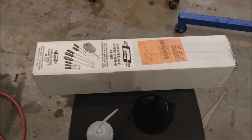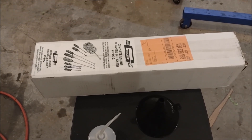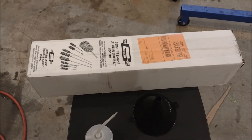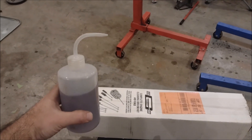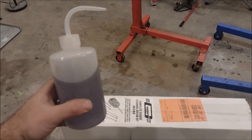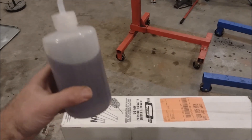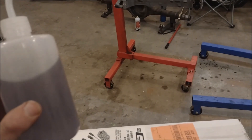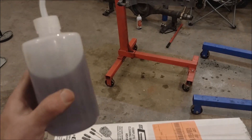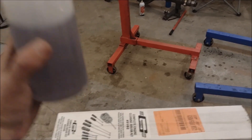For cleaning the oil passages, we've got two of my favorite tools in the whole shop. First, this box of engine brushes — I go through one of those pretty much every build season. They're cheap, although like everything else they've gone up in price, but there's a whole bunch of different sizes for getting into all the different oil galleys. And then of course, good old trusty squirt bottle full of gasoline. I use gasoline instead of brake clean for a few reasons: it's a lot cheaper, the fumes don't kill me quite as bad, and since I painted this block, the acetone in brake clean would make the paint run. Plus, since I switched to E85 last season, I've got to use up the rest of this race gas somehow.